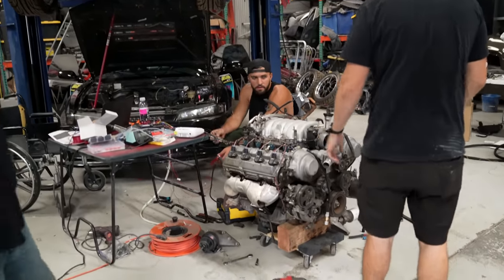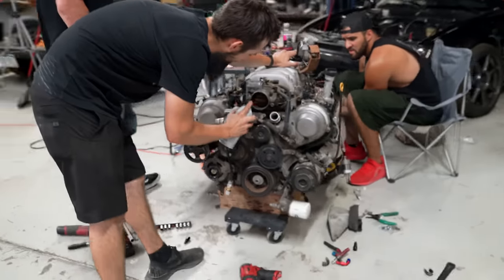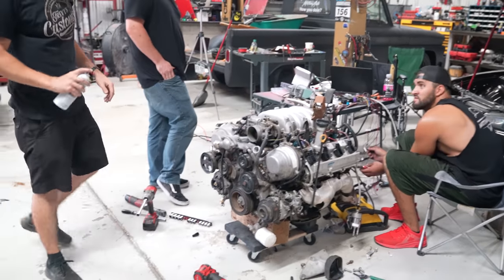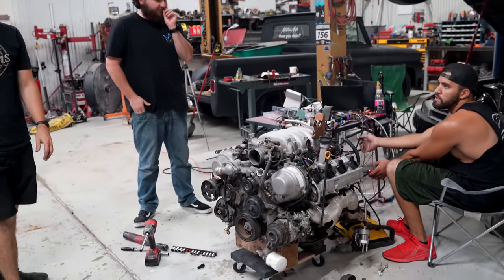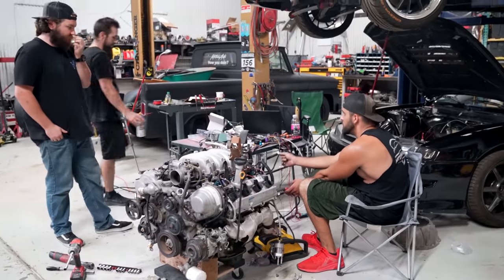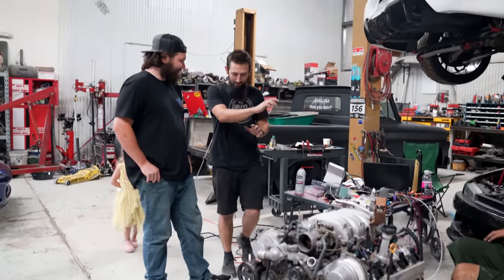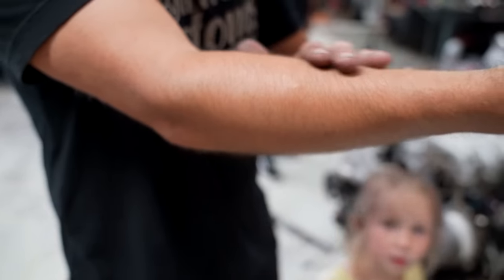Yeah, you need to be our motor mounts, Blake. Give her a little. You got that? Ready? Woo! Probably doesn't like that because of the way the coils are batched. The coils are batched, so it's not gonna like starting fluid. It's only gonna like fuel because the fuel is only going in that cylinder when it's supposed to. And spraying it that way is gonna cause that. Batch fire. Yeah, did you see that? Look at my arm hairs. I about burned my leg hair off too right here. Did it go out the bottom too? A little bit. So yeah, all my arm hairs right now got a little singe.